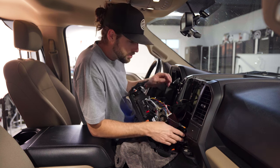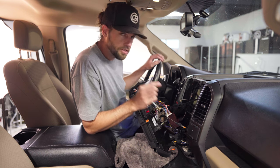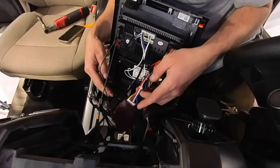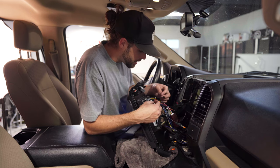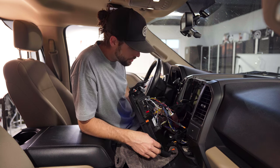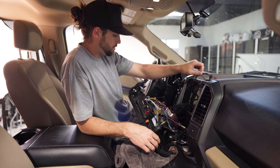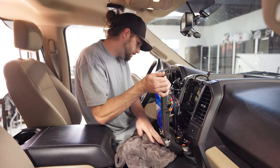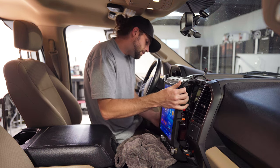To summarize all connections: GPS cable, antenna to the black connector, blue and yellow single-pin rounds are not used, the big adapter connects to the wiring harness with connections below, yellow RCA connected for the camera, and all the small white-end connectors go into the head unit. The two lower black factory cables connect as well. Keep the wires up top for traction control, hazard, and auto start/stop, then thread cables in and set it in from the bottom.